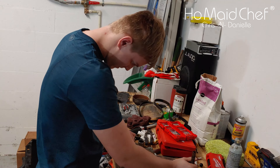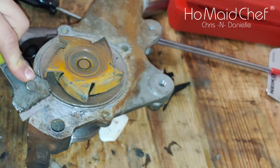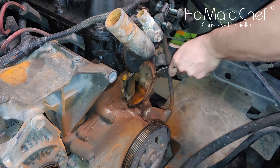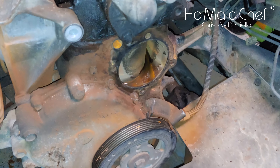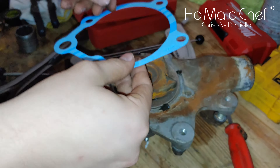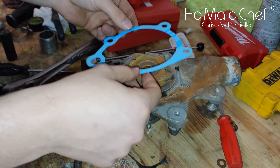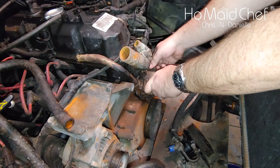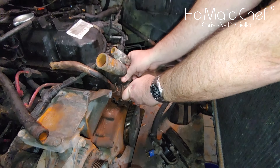My son is working to clean the surfaces so they'll be nice and we can stick the new gasket on. Getting all that rust off around there. Now we have all the surfaces cleaned up for the water pump. Before we stick this on we've put a couple dabs of silicone to help glue the gasket so it doesn't move. We've also cleaned up the threads on the bolts so they don't affect the screwing on.